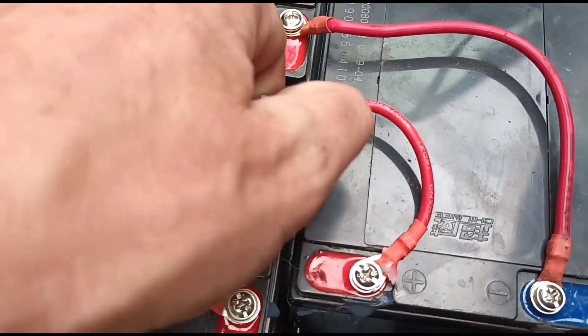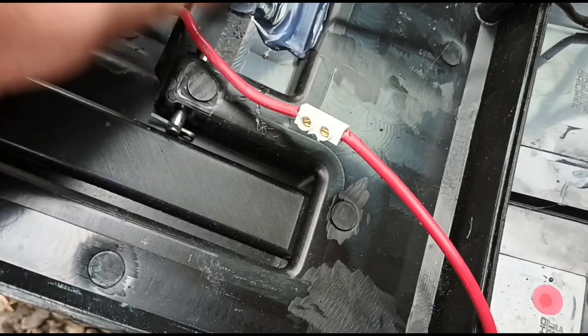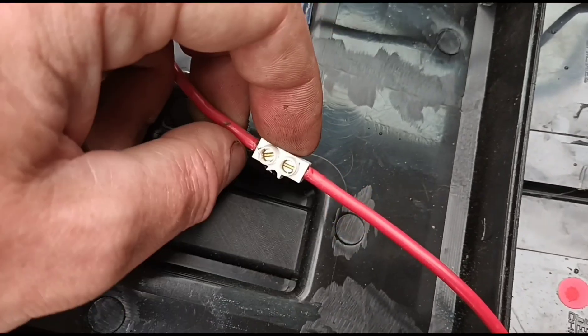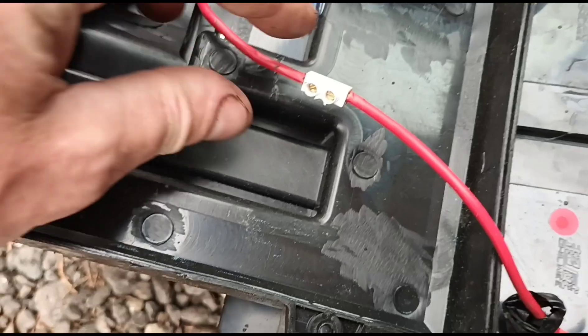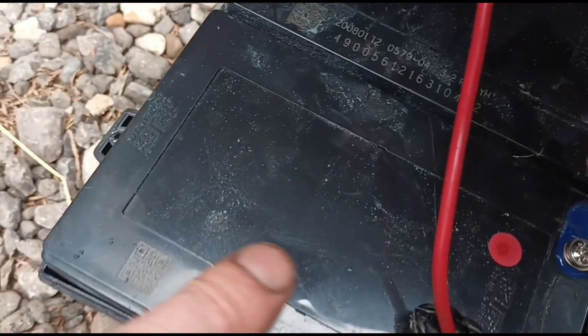Just going to get this glue off. I recently had a similar problem with this bike - it had a little plug clip that had melted, so I replaced it with one that's a nicer tighter fit. On a live connection, if you've got a loose connection it generates heat and melts, but a nice tight fitting doesn't heat up as much. I can already see there's green oxidation all over the top of the battery - you can see where they must have been leaking.